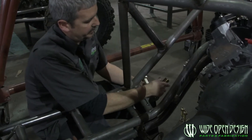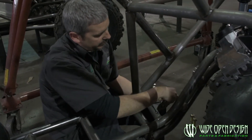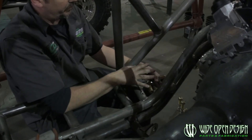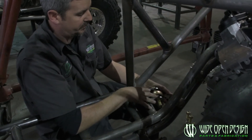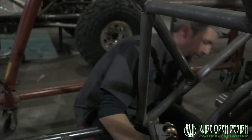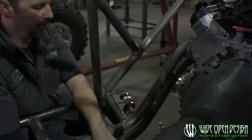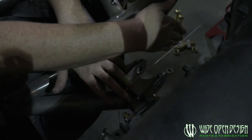You can get into some pretty crazy limitations, so you make sure the bolt, spacer and everything come together. We know where we want to place it, but you don't really know how to put it exactly in line just yet. Step one: find out the placement, then make sure it gets in line where your heim joint is going to run straight. What you want to do is grab a piece of string. Mark out on the axle side where you want that tab to go, run your string down there, then come back up and use the string to make sure your tabs get straight.